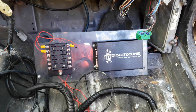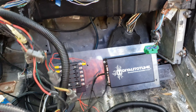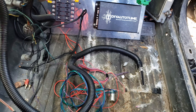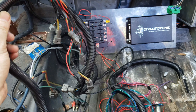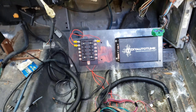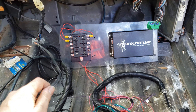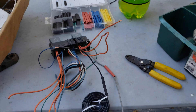I'm gonna let the cat out of the bag — the standalone system I'm going to be running is the Megasquirt 2. I had to get the DIY one; it comes with an eight-foot harness with all the wires terminated to the same length running to the pin that plugs into it. I had to cut the wires, run them out to where they went, and solder the connectors onto all the wires. Now all I really have left to do is run the power wires to the fuse box I got for it, and then take all the ground wires and make a spot for them all to terminate up by the battery.